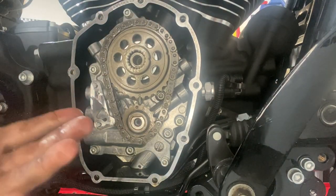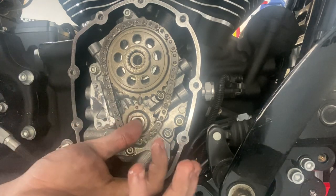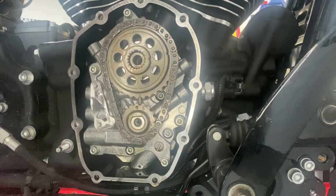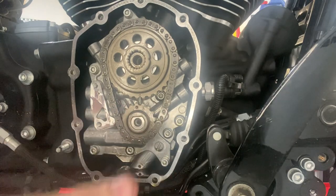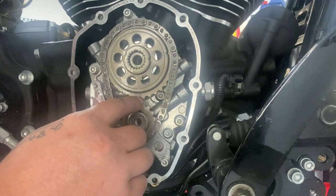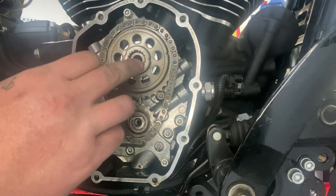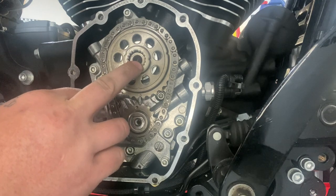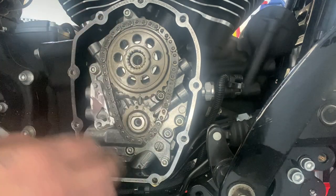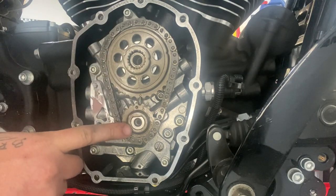And now this is where we'll be putting our red Loctite on our bolts and starting them. And when you get them snugged up by hand, we can go ahead and put back on our lock tool. And then we're going to torque them both to 15 foot-pounds. We're going to back them out one full revolution, 34 foot-pounds, 24 foot-pounds.